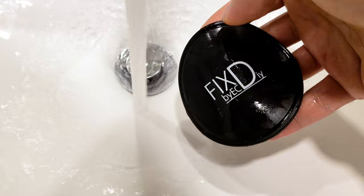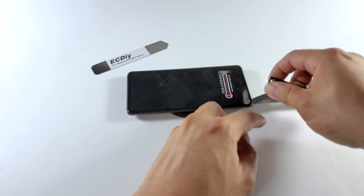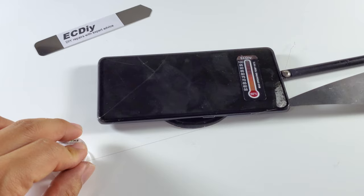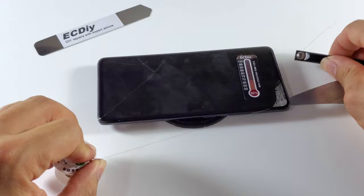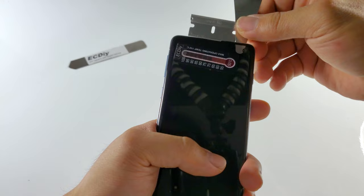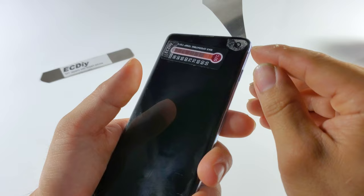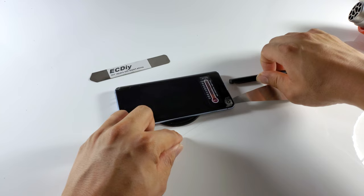Place the display down on the gel pad, apply heat, and using our patent pending OCA blade as a guide, take the wire tool and slice through the adhesive layer. Try not to overheat the display — if you briefly reach 100 degrees Celsius it's okay, but beyond a few seconds display damage may occur. An important tip for phones that have a curved display: you want to hold the OCA blade straight and slowly slice the adhesive layer up to the midpoint of the curved edge before inserting the wire tool. Otherwise, the wire can catch an edge and tear the display.